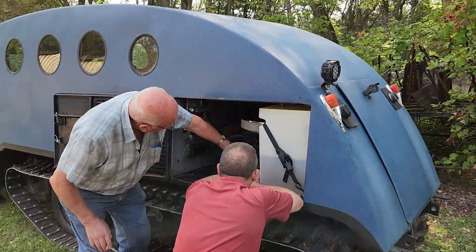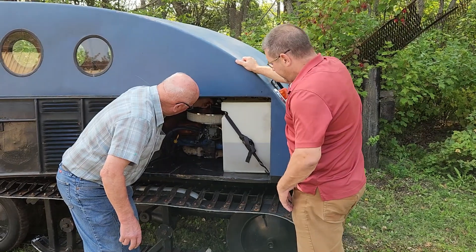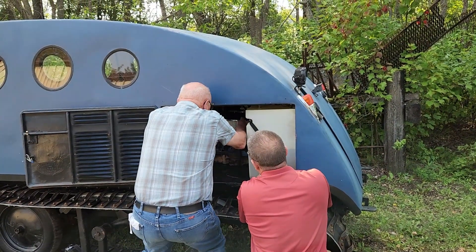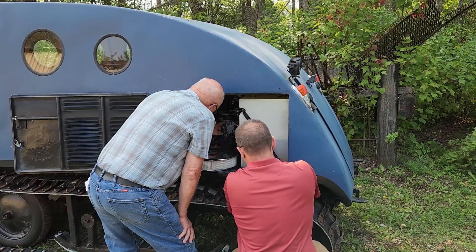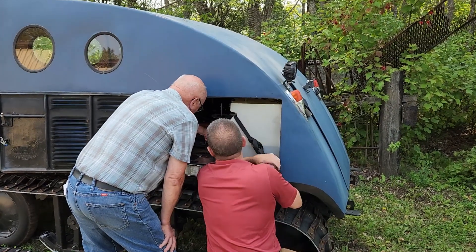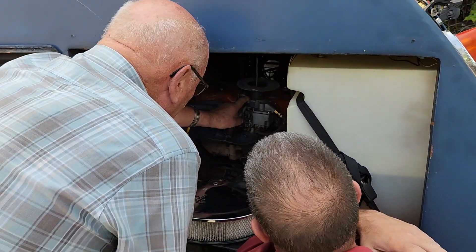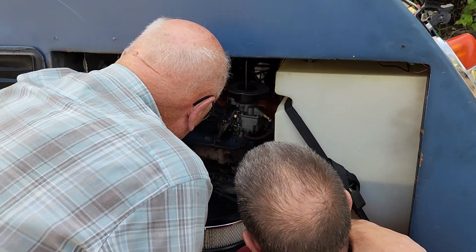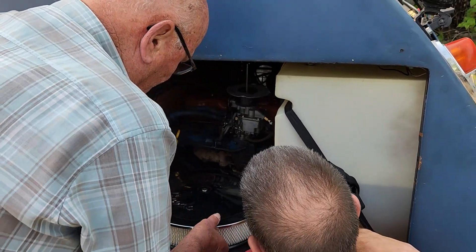There's a base on here I want to show you, just in case you take it off. I made this long for a simple reason — when you go to put the top on it, you see this carburetor is bigger than the one you had. So I got this and it's plumbed into both of those PCV valves. Remember how it used to hang down on the other side? This pulls it into the carburetor.